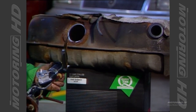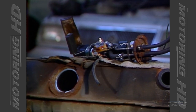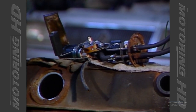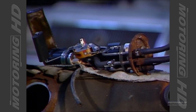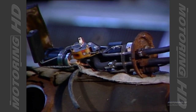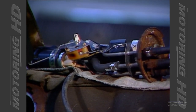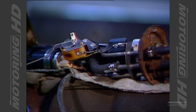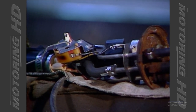Don't expect to get a whole lot of warning when your fuel pump starts to fail. In some cases you may get stumbling or stalling in hot weather. Or if you're real lucky, you may have a severe performance problem where you can drive the car into the shop but it won't maintain road speed properly — it just doesn't have the power and stumbles and surges. But by and large, the typical fuel pump failure in this type of pump assembly is a complete failure where you have to get the vehicle towed in.